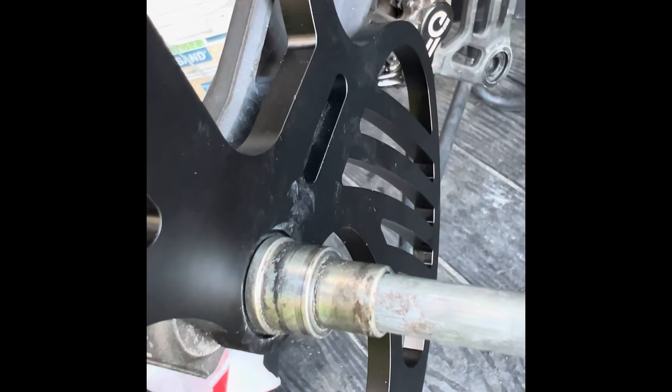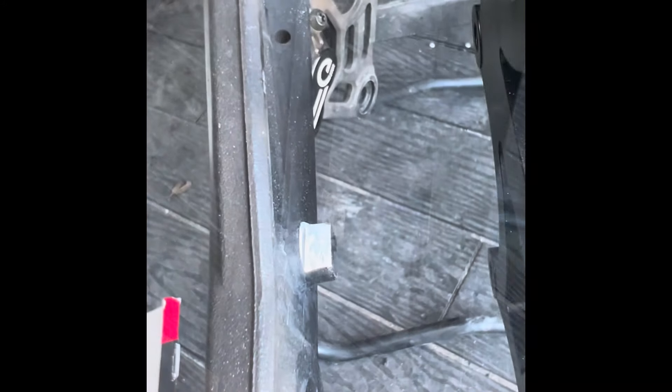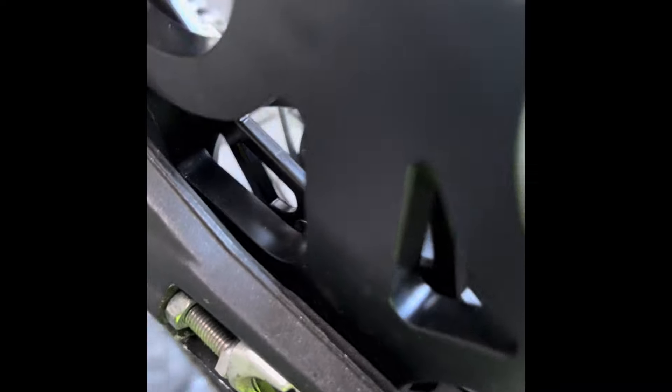I might try and pull it back off and remove that. I've had this tire on and off like six or seven times — I could not figure out what the problem was. Turns out it's pretty much what I said in the first place. See that clearance issue right here at the top — it just doesn't want to go all the way on, so when I put the rim on it's cocked and I can't move it back and forth. So I'm going to take a little file, file that down a bit. There you go — I filed that off and it definitely fits a lot better now. It actually goes all the way and there's no clearance issue.